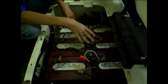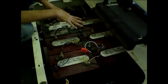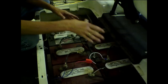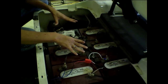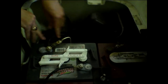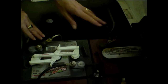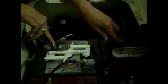This is a typical setup for an EZGO. As we showed you on the Club Car, the two main wire sources are the series ends on the driver's side and the passenger's side. On an EZGO TXT, you're going to find them over here on the passenger's side. This is where your main wire heads back to the controller — same thing with this one. We're going to use our positive and negative to hook up our source for our meter on this particular EZGO.